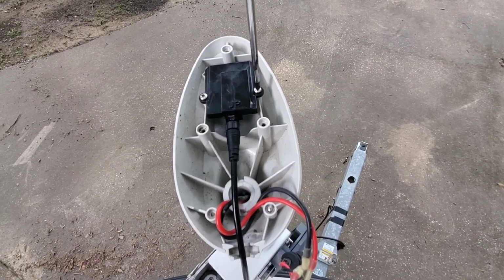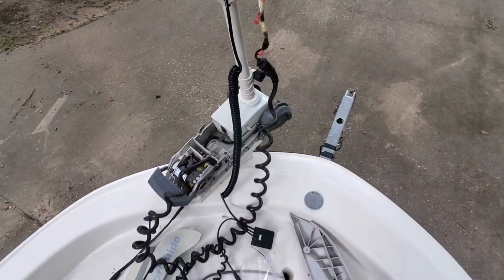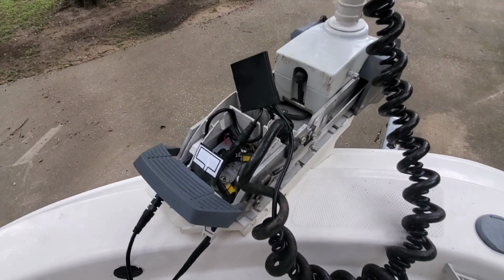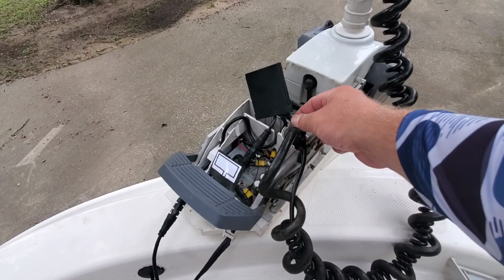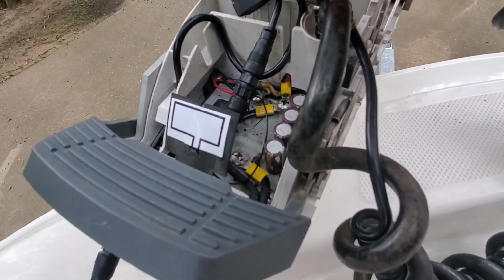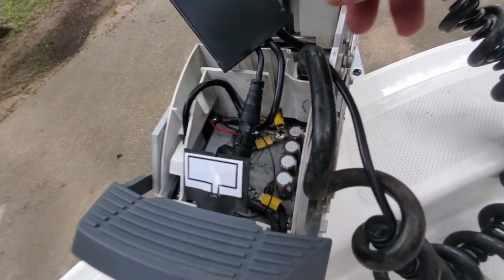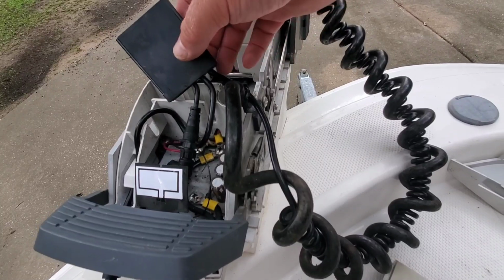Once you get this on, now you're going to have to ravel this thing in between the power cord. And I'm going to save everybody some time and do that on my own. Now when you go to put this bottom GPS unit in, I zip tied to the power cord so this top one don't jump out of the track here. Both of these are going to go through this slot right here. You see the slot right here? Both of them wires are going to have to go through there, so you'll have enough room to pull this down so you can put the plate back on.